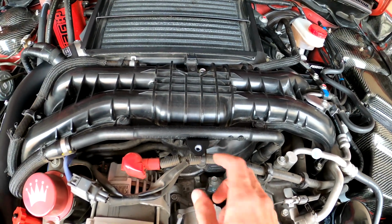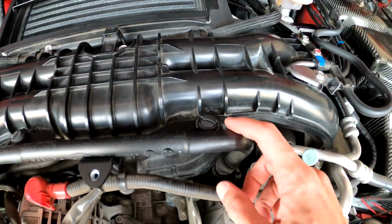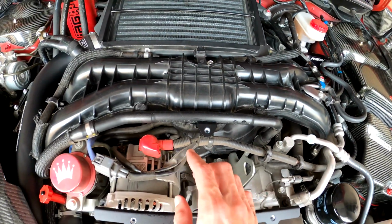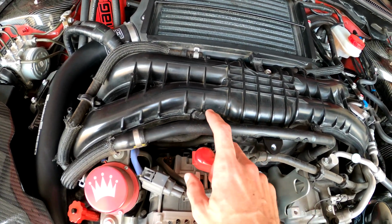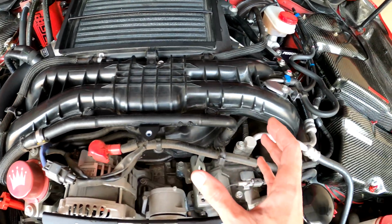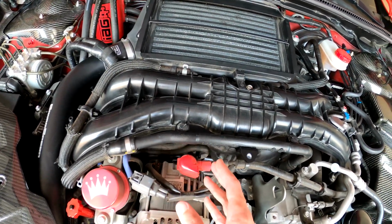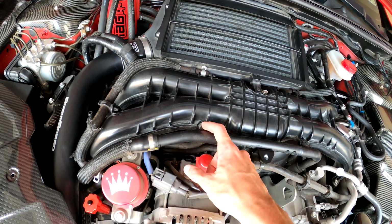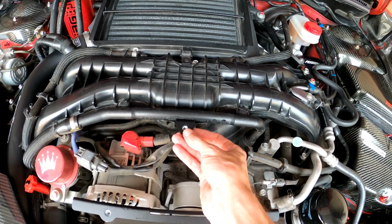With the top bracket, now I have it put in with these 2 push clips. And I did want to note here with these push clips, I did have to use a hammer to kind of tap down on them to get them to set, and it worked for me. But if for some reason your push clips happen to break, you can always use a bolt with a nut on the bottom side just to hold this bracket on.